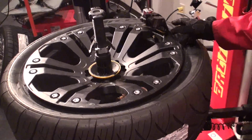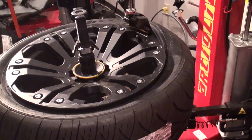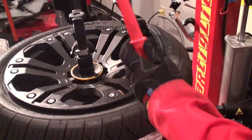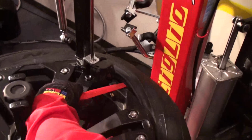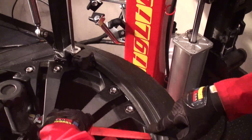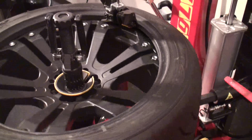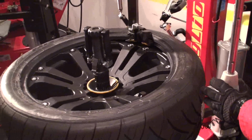It can happen, especially with very deep drop center, that now you start spinning and the tire does not jump on top of the rim. That's why this device, you just stick it basically right there. It's Teflon, so it won't scratch the rim. It just helps the tire jumping on top of it. And makes it very easy.